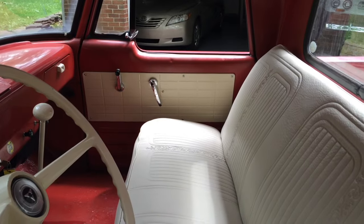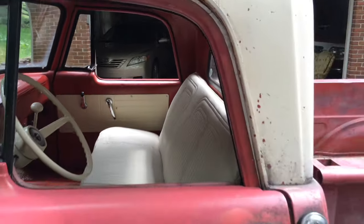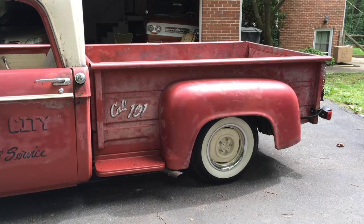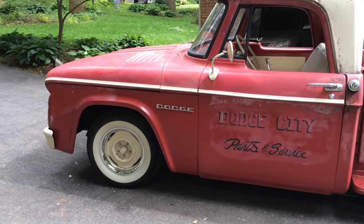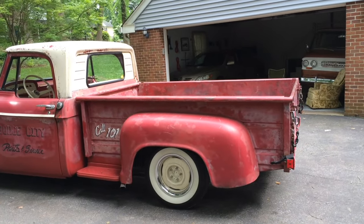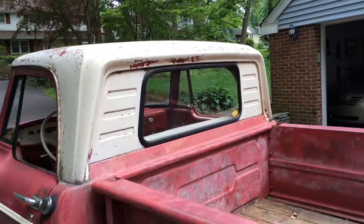It's just a nice driving truck now. Brakes are top-notch. One of the first things I did was notice the rear axle seals were leaking, so I yanked out the rear differential, pulled the axles, replaced the seals, and replaced everything in the brake system from the master cylinder down to the shoes, hardware, hoses — even the hard lines are new. Everything is 100% on the brake system. The clutch is strong and firm, operates at the top of the travel, shifts tight and smooth, no play at all in the shifter. It's just a nice easy driving truck that's dependable and starts every time.